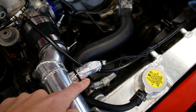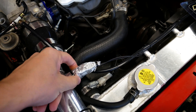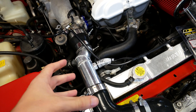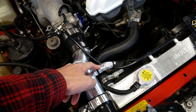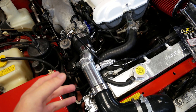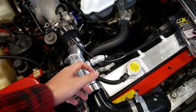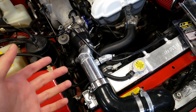I've got the sensor all wrapped there in the heat shield and it actually wrapped pretty nicely. Note that ideally I would try to wrap all the intercooler piping and everything in the area to prevent even the piping from getting hot and heating up the sensor. So this is not a perfect solution, but it should be better than it was. You should try to plan out a place for the sensor where it's not going to heat soak, and still wrap it to try to prevent heat soaking.